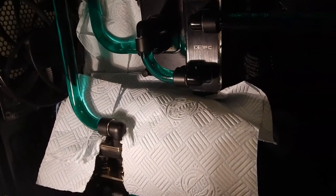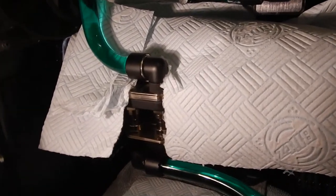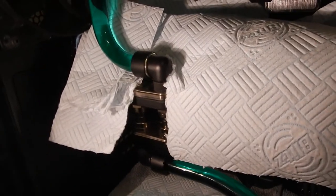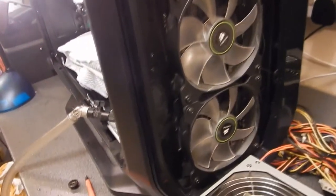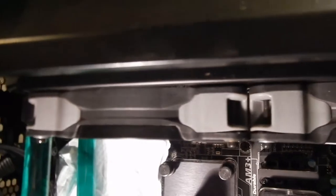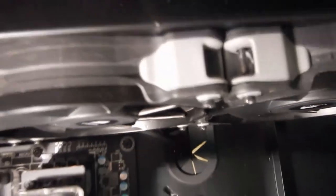It's only an 8350 on a Gigabyte UD5 motherboard, two AMD Radeon 7950s in there in Crossfire, the 3 gig cards. It's got an Alphacool 30mm thick 360 in the front with three of those Corsair LED green fans in it, and the top radiator is a 60mm thick 360 Alphacool, and it's got three SP quiet fans on it. Majority of these fans, four of these fans, two at the front, two on the rad, run on SpeedFan. The back one and the bottom one run on the fan controller off the 780T,